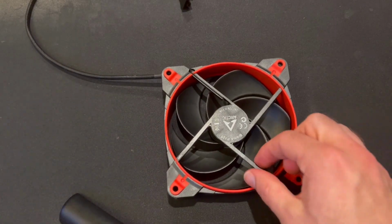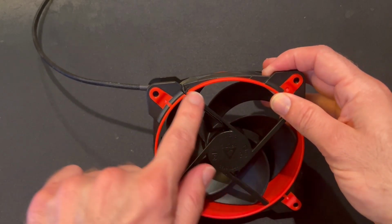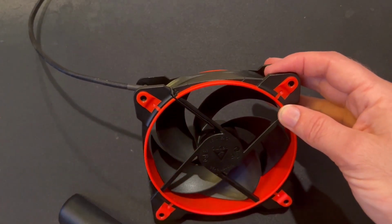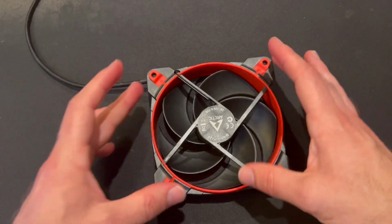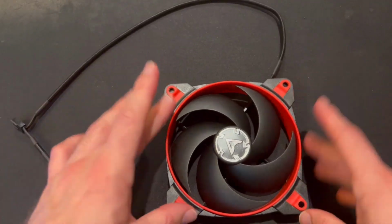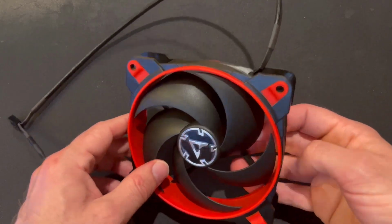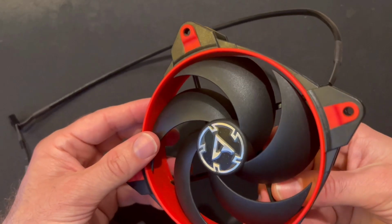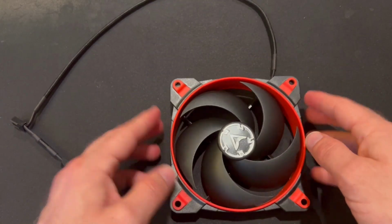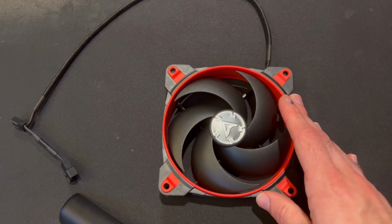On the back, it basically looks identical. It has nice thin struts, and the cable running into the motor is very well aligned, creating this nice thin little profile so that it's obstructing the airflow as little as possible, so that as much of the air coming out of the fan gets, well, pushed out the back. So that is a very good feature about this fan. The struts have a fairly aerodynamic shape to them, just a basic semicircle, I would say, maybe a quarter of a circle. So that's pretty good. As far as the fan blade, well, it looks near identical visually to the P12.